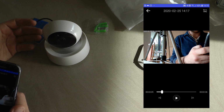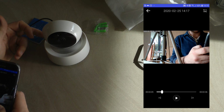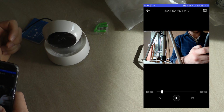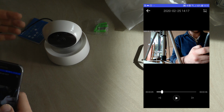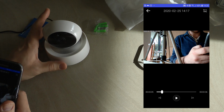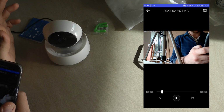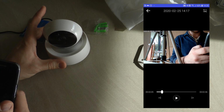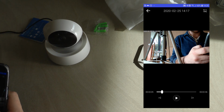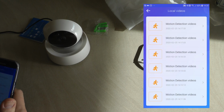And of course, you can always take out the SD card, put it into the laptop, and these recordings are going to be in separate files. And the files are going to be in separate folders. So I think there is going to be a separate folder for day, every month. So it's quite easy to look at the footage that you are looking after. And I've checked in VLC, and the videos are H.264 codecs, and so around 10 frames per second, full HD, and mono 8 kilohertz audio. So yeah, the audio is fairly basic, but I think it's good for this purpose.